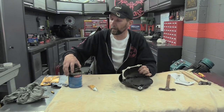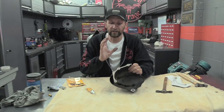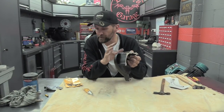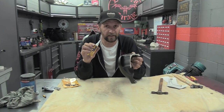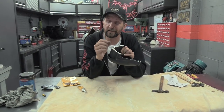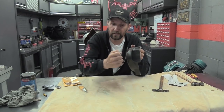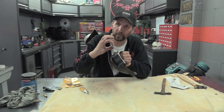One last final thing I want to say about this: the advice even on the packaging is to do up a joint, a casing, whatever, when you're using blue Hylomar, in two stages, and that's to allow the product itself to squash into place. So do it up wrist tight so it's nice and tight, and that's enough. But before you torque it down, give it about 4 or 5 minutes, then come back to it, then torque it up, and that gives the Hylomar a chance to squeeze out.